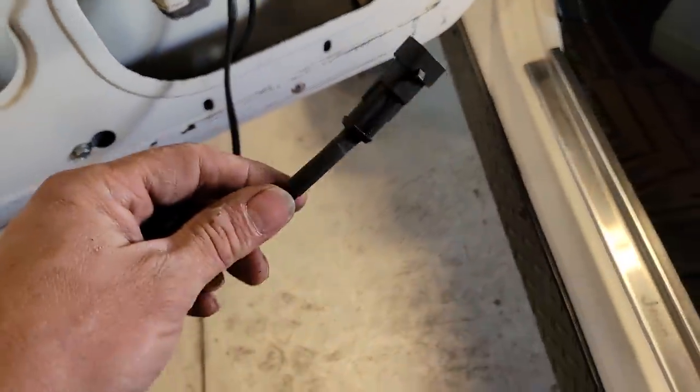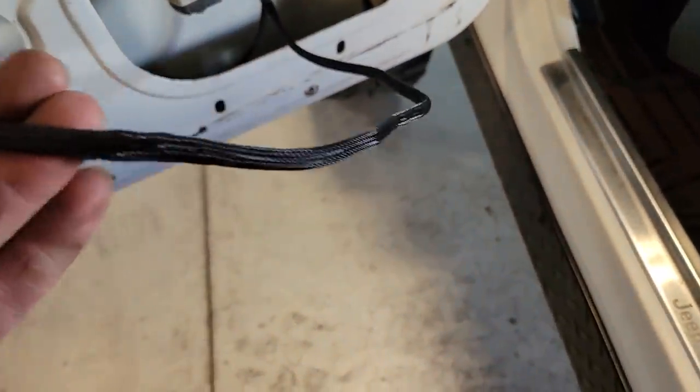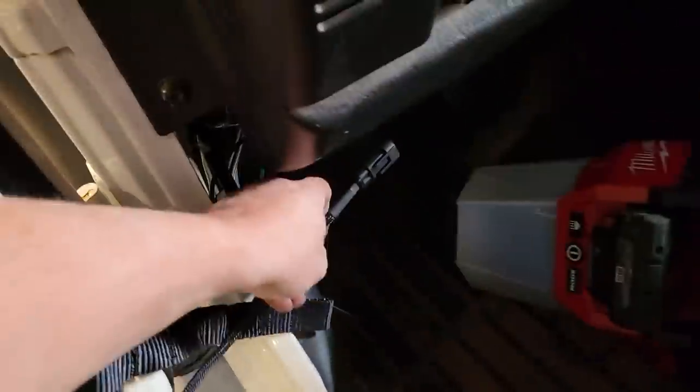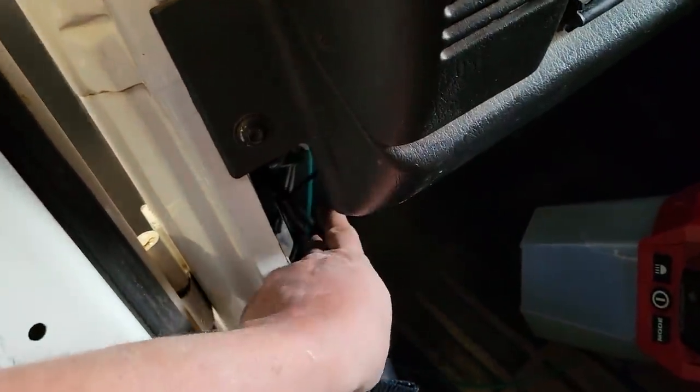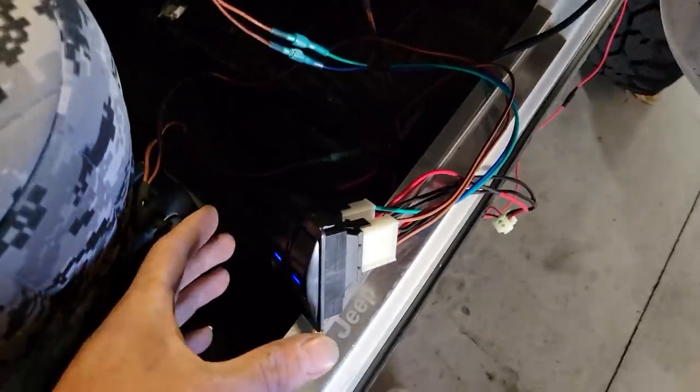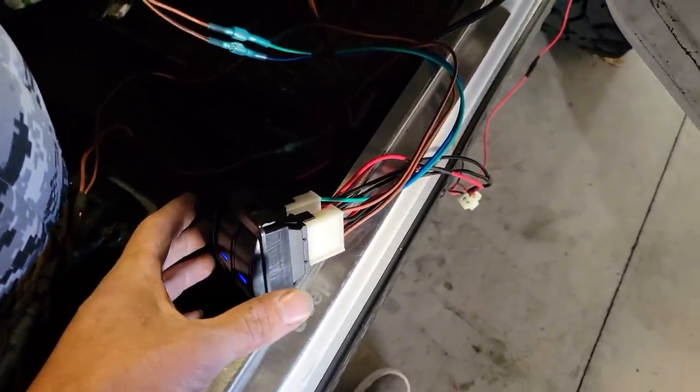I am so excited right now. Beck's putting those fuel filters back in. We got these made up — here's our connector. Nice PET-wrapped all the way up to the motor, these will go here and the connector will sit right under here. Then we get to install the rest of the wiring — I'm going to modify it so we're not going to have a passenger door switch, just the masters. So I have to rewire the passenger side to be a passenger master. Here goes nothing — I just have the power plugged in and the motors ran. This thing lit up, so I'm pretty happy about that.